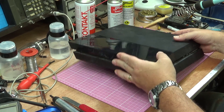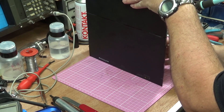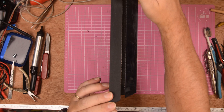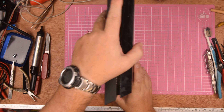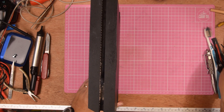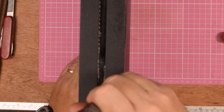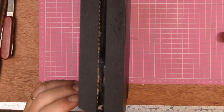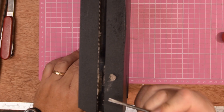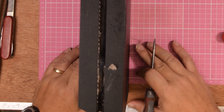Now, it's usually aggravated and brought on a lot quicker when they're not mounted flat on the table. But when they're mounted up on their end, like so, what tends to happen is you block a whole side of the air intake system. I have taken some of the muck out on this one — this is a combination of skin, hair, deodorant — it's dust in your house.